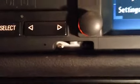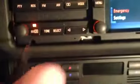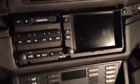I've noticed that if you're using a really thick screwdriver, you can't clear the plastic of the display to get in there, so I'm going to use this one here, which isn't magnetized, so be careful that you don't lose these 4 screws. One's located here, one a few inches to the left, and then one in each top corner. Key now out of the ignition, 4 screws removed.